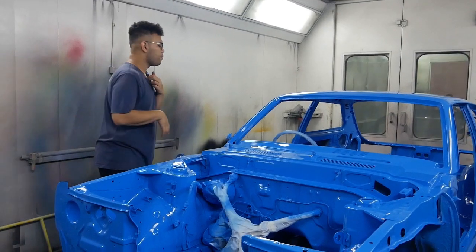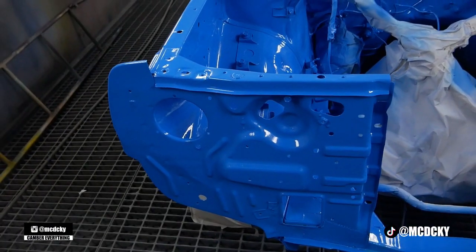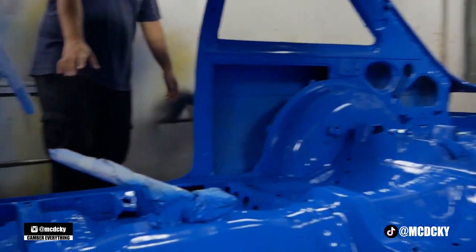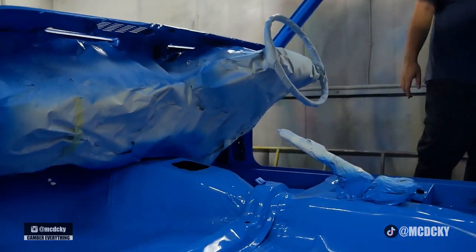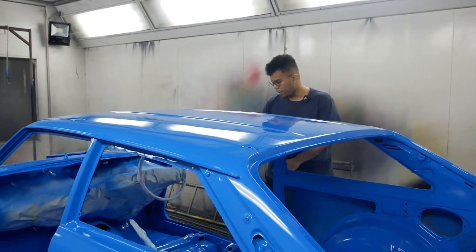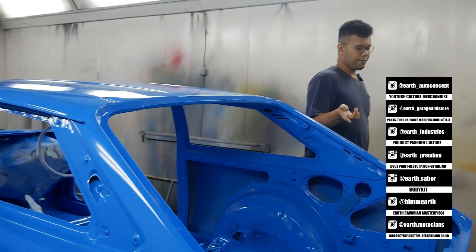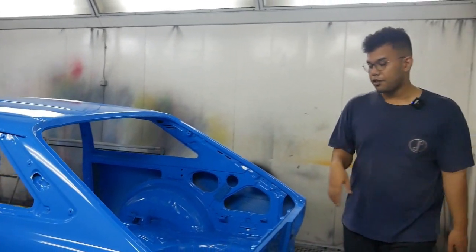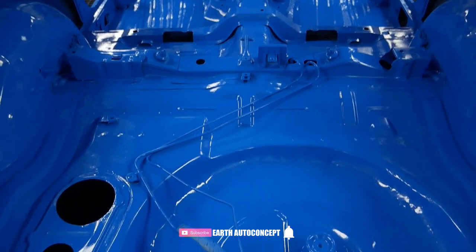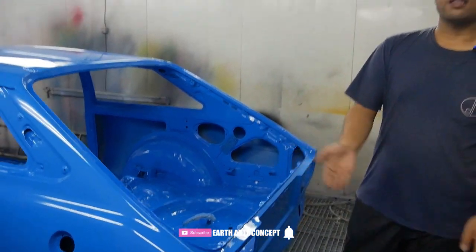The lower fenders will all be painted black. We focused on the top first — everything has been painted, including the interior. The floor panel that was full of holes has been rebuilt one-to-one matching the original, filled with putty, seams cleaned up, and painted all the way to the back. As you saw in the previous video — the spare tire well was also full of holes and we rebuilt it with the correct bends, just like the original.